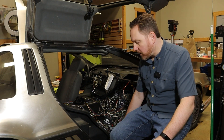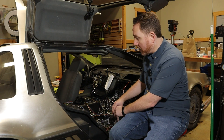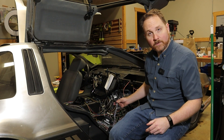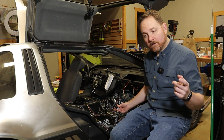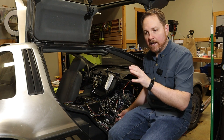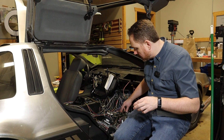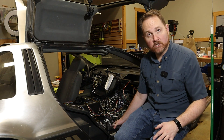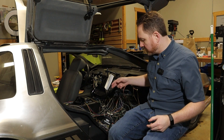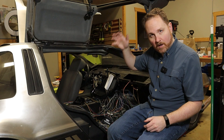And that's true. But if you start at a module and say you're going to move it to where it's going to go, and then you cut all these wires one by one, move the module, rewire everything, and then move on to the next module - you find out those wires were connected to the first module. So you end up taking the same wire and cutting it and splicing it over and over. All four of these modules are on the main CAN bus in the Chevy Bolt, so each one has two CAN wires coming in and two coming out. They'll all be sitting right next to each other, so those CAN wires can be six inches long rather than cut-splice repeated multiple times.